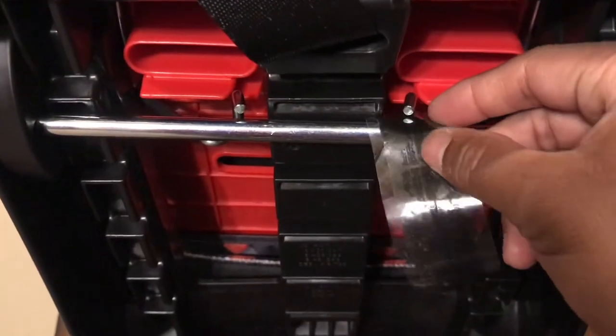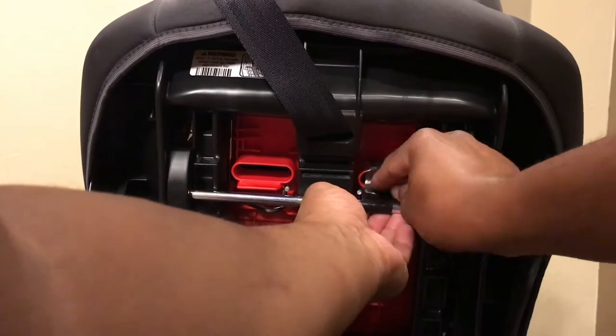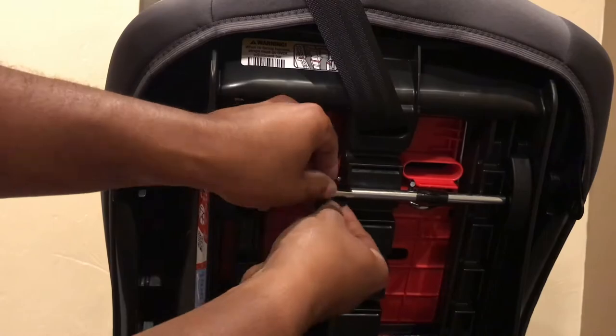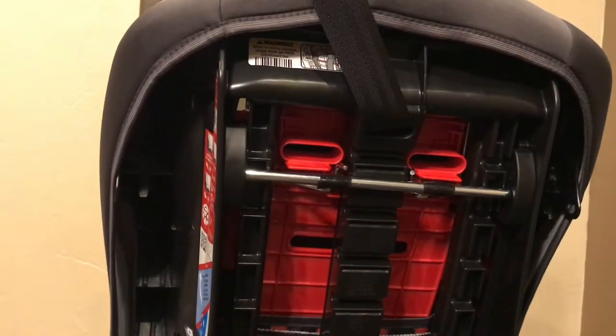I'll show you how I went about fixing it, which was just with some tape. I first made the headrest all the way up and then dropped it down a little to go in between the two lock positions, so I could gain access to where the two bars are clicking on each other. I just lined up the tape where those two pieces of metal meet to quiet it down, and did the same for the other side.